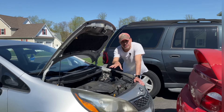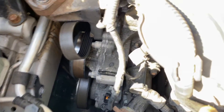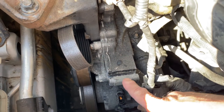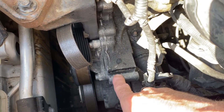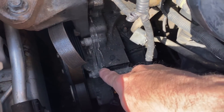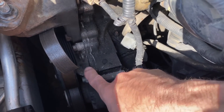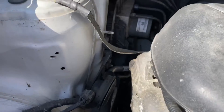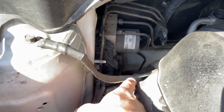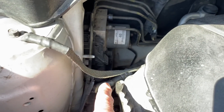Let me show you over here where the alternator gets mounted. You'll see this is the mount — you have the stud that goes through the alternator, slides on each side, kind of pinches that in, and then you secure the bolt right through there. That's where it's getting its ground, and that's what we're going to be testing. Now back here, this is our ground off the engine block — it goes on the back of the engine block and then it's mounted right here to the body itself. We're going to be testing that as well.